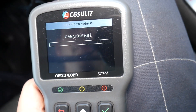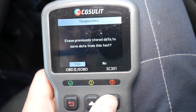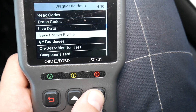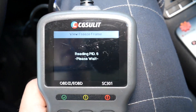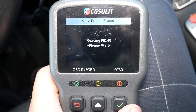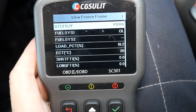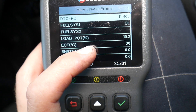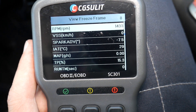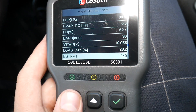Going back to OBD — since we have one code, before we start I'll go to the code. We'll click Engine and then go to View Freeze Frame, which shows you the exact conditions when the engine light occurred — the engine temperature, throttle position, oxygen sensor readings, air intake, RPMs, and more, so you can quickly figure out what's wrong. The code is P0100. It shows engine load was 19.2%, coolant temperature was 30 degrees so it occurred on a cold engine, RPMs were at 1,433, and spark advance was negative.